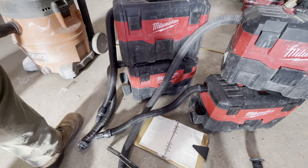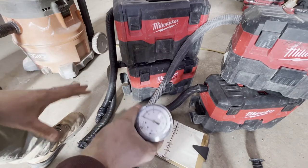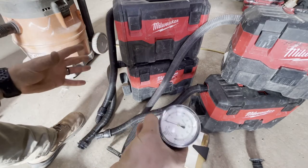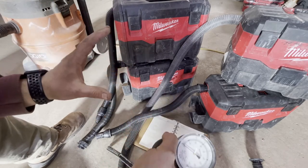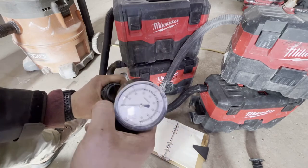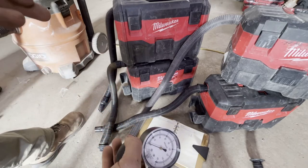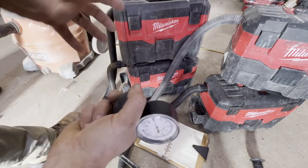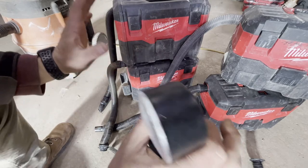So that's it — we tested them all. Sorry I don't have a wind speed meter right now, but I may redo this in the future. If you're wondering whether connecting more vacuums increases water lift, it really doesn't seem to. But you do increase the amount of airflow. Hooking all four up to a two-inch pipe creates faster vacuum speed, which can probably pick up more solid objects. But when it comes to sucking up water or something that gets stuck, the big corded vacuum will win. That's my take on all of it — hopefully you enjoyed this, see you guys next time.